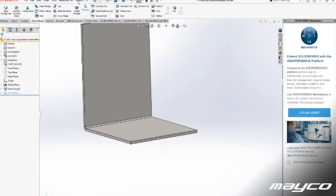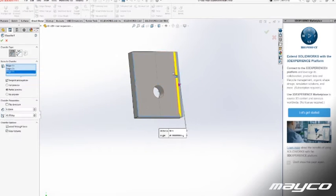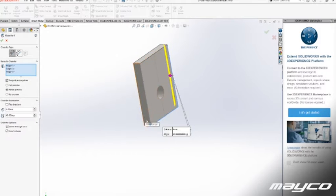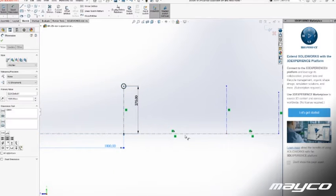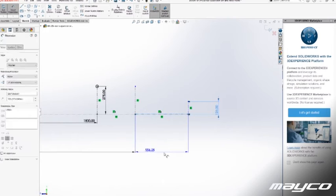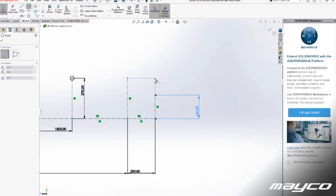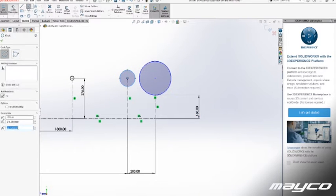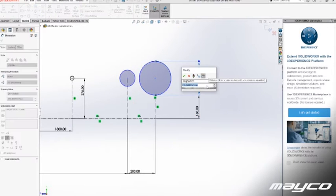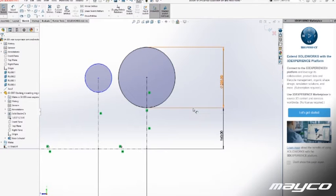And the other point is, you might say, hey, why are you forcing yourself to work in such a small area? Why not put your disc brakes on the outside of the chassis? Well, yes, in theory I could do that. Two reasons I don't want to do it. First of all, as I just mentioned, I hope to switch to independent suspension at the rear, so with drive shafts. I know I don't have a lot of suspension travel, so I could do with a very short drive shaft.